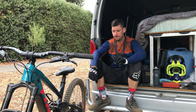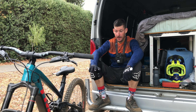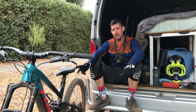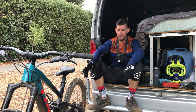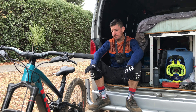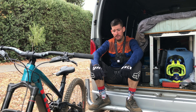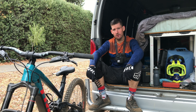So there you go — changed my thoughts and we've all learned something. That rear shock feels good at three clicks of compression. It's not overly supple. I'm not getting more performance out of it than the air shock that came off the bike, but it's consistent and it's going to feel the same every day and I don't have to put a shock pump on it. So I'm happy with that. I'm going to keep playing, keep tuning, see if I can find something, learn some more. But for now, that's a little lesson in spring rates and setting up a coil, I guess.